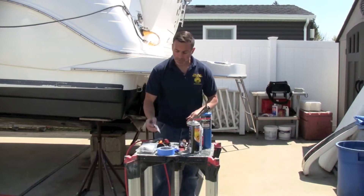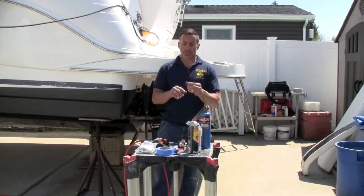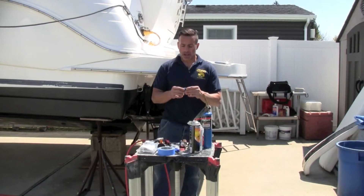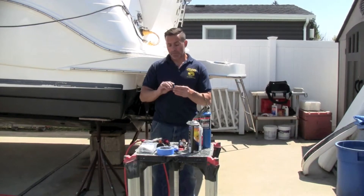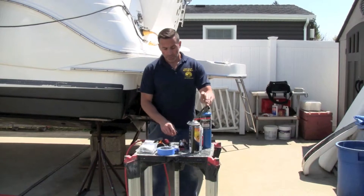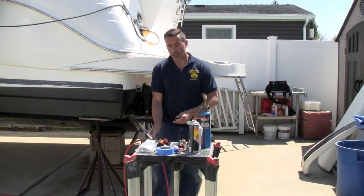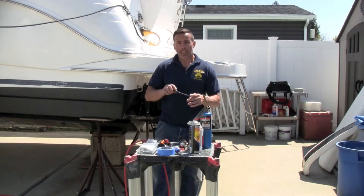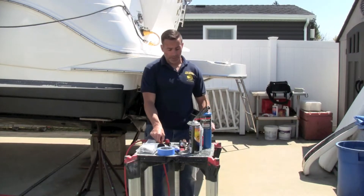I also got some petcocks on Amazon. The reason I got them is because when I went to winterize it they snapped. That happens from time to time and you're going to have to get out the little piece of plastic that's left in there and make sure the threads are good. With a torch and a screwdriver, I'm going to heat the screwdriver, cut it down with a hacksaw to a flat level, heat it up, and pick out the plastic with some scribes.